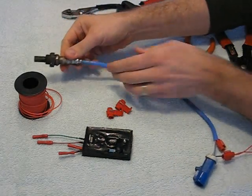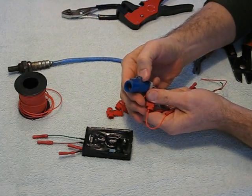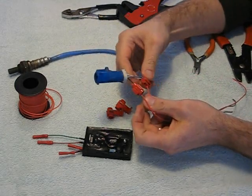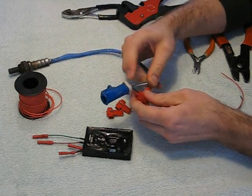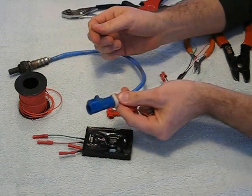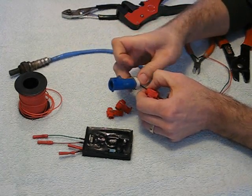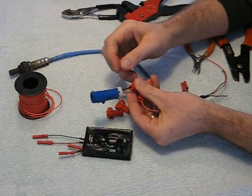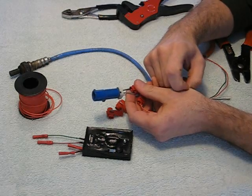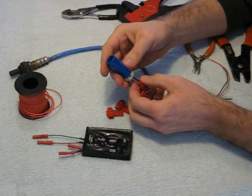We'll be looking at the wiring. Follow the O2 sensor back to the plug and unplug it — there's just a little tab you press in and you can pull it out for doing the installation. With the O2 sensor still plugged in, you'll take a needle, like a sewing needle or a safety pin, and you'll start to pierce the wires one at a time and measure the voltage. It's a DC voltage — it should fluctuate between 0.1 and 0.9 volts DC, and it should fluctuate very erratically when the engine is warmed up.